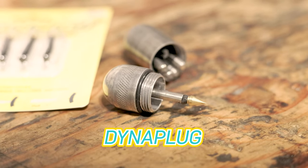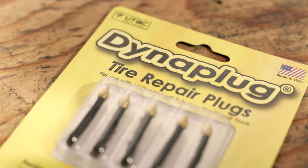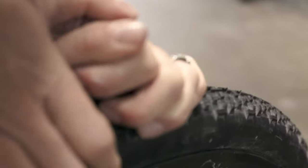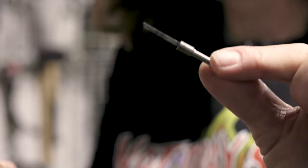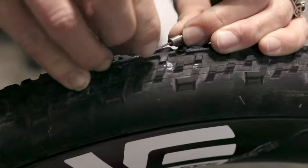The first type of plug we're going to talk about is the Dyna plug. It comes in this strange little pill bottle and has this little dart that's set up. When you have a larger puncture, you're going to shove it into the hole pretty aggressively and yank it out. Gently pulling this out, you can see it has this little tail. The Dyna plug does come with a little tiny samurai sword that you can use to cut the tail off, but honestly you don't even have to worry about it.